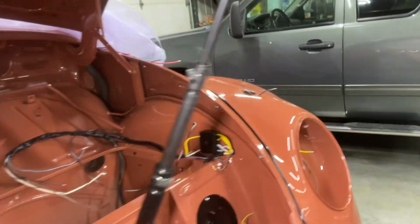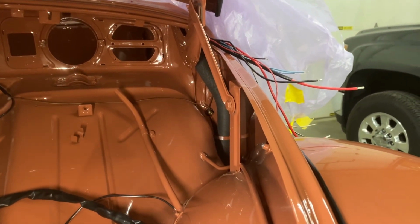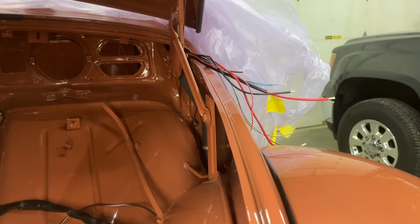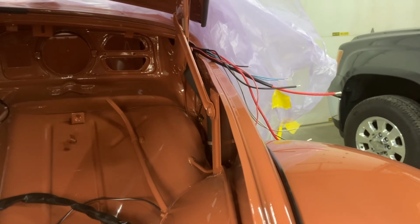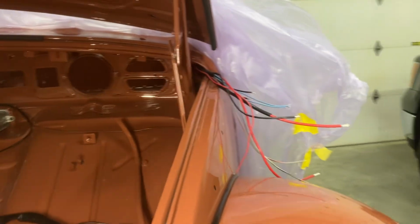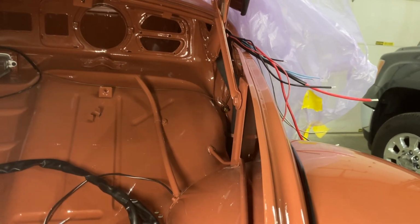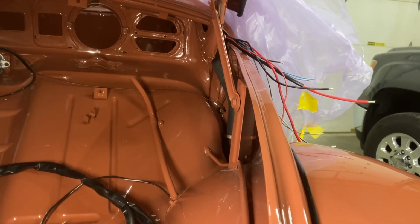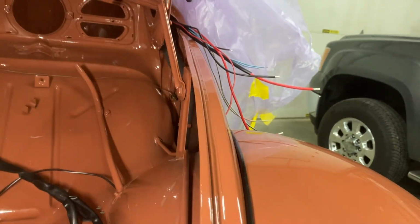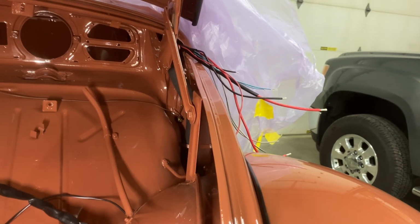This is a 60, so the main wiring harness runs through the roof on the left, driver's side. You can see it coming out there. So what I did is I pulled it all the way out. Some people will follow it with a wire, so that when you need to, you can just attach the new wiring harness and pull it through. What I did is I started fresh. I snaked one up through there, and it wasn't too bad.